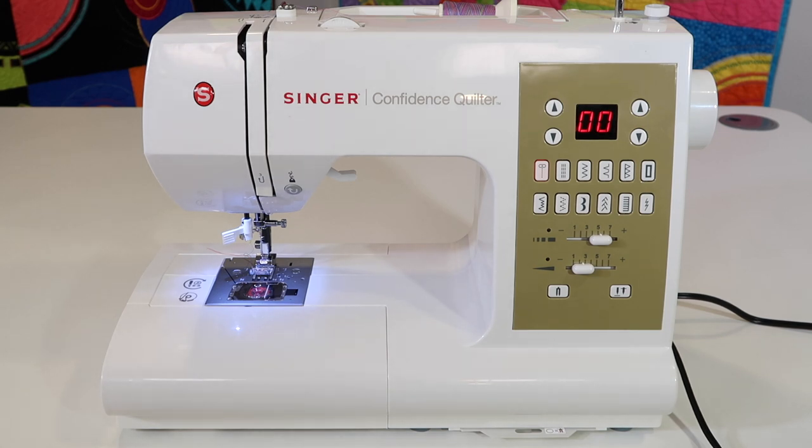I'm going to give you some tips on how to clean out the area below your throat plate. But before we do that, having your machine cleaned annually at your local sewing machine store will also be beneficial. There's so many things that you and I can't reach — behind all those covers — that they will be able to go in, do adjustments, clean and oil all those moving parts. What I'm going to show you is something I recommend to my students to do every three to five bobbins.